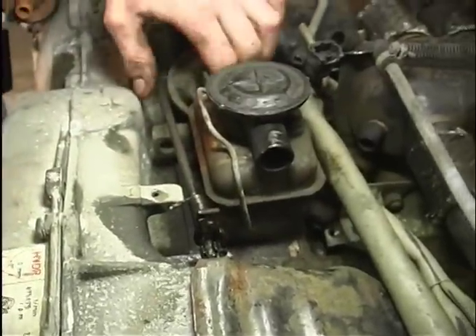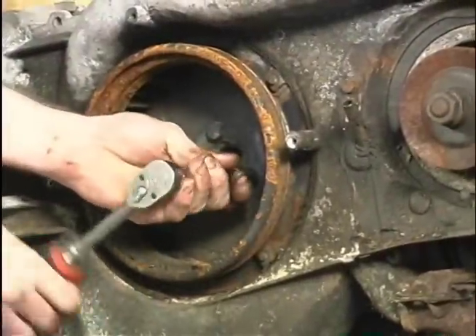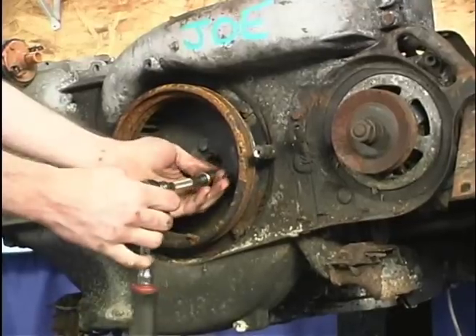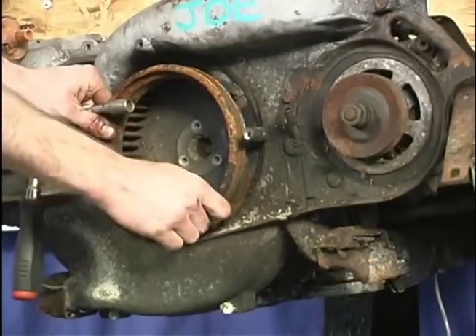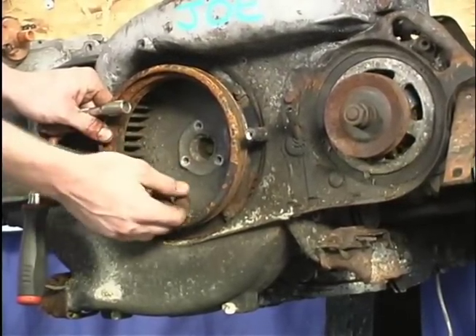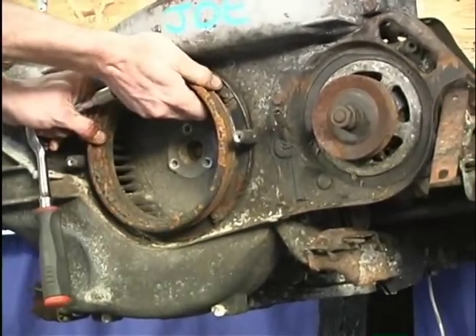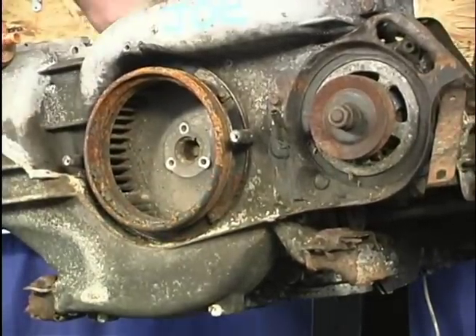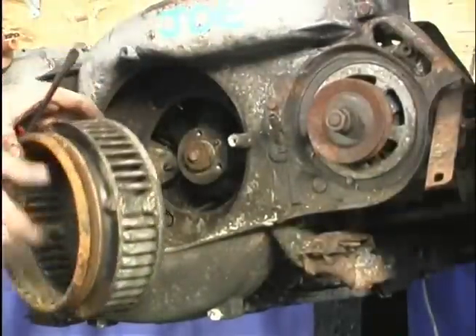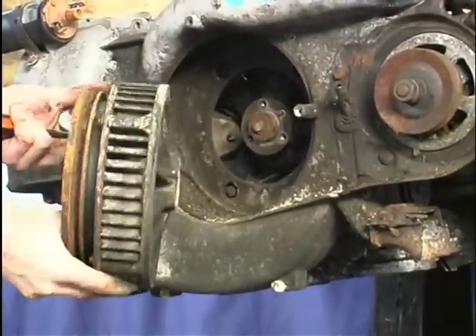While we're up here, we're going to go ahead and pop the top of the breather chimney off. The cooling fan is a little bit different than what it is on a Type 1, because a Type 1 would normally have a pulley here with a place for a belt. After you remove the three 13 millimeter bolts — which are special bolts with a different thread pitch — you need to retain those. You can give it a wiggle back and forth. When you get it out, you want to inspect it to see how many fins are broken. This one actually looks like a keeper — it's in pretty good shape.